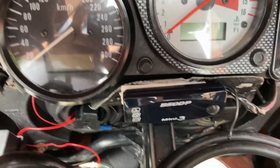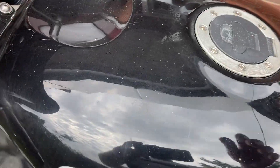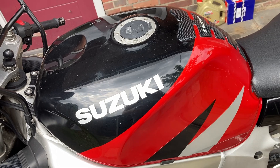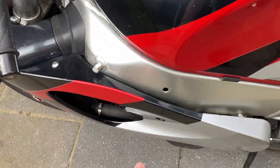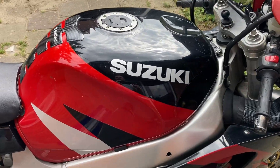I just got back from the ride, I had a really good run. Now I have to take off the seat, open up the tank, make access for the injectors, and then I can hook up the sync device and check the sync. I hope it's still good — if not I'll adjust it. When that's done I'll take off the device, let the engine cool down a little, release the oil, and open up both sides to take off the covers, because one side is the reservoir for the coolant and the other is the oil filter. So let's open up and hook up the device.